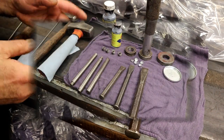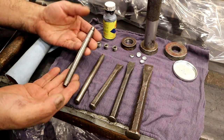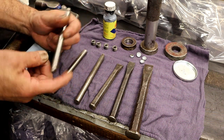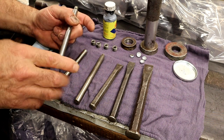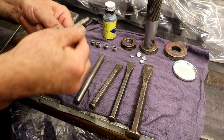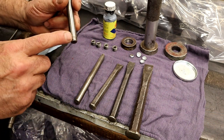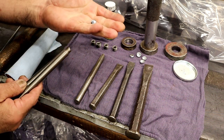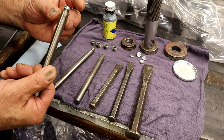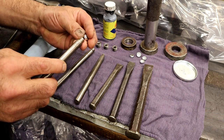Here are all the tools I use to put in these little plugs. What I do is use Chevrolet fuel pump rods — if you're in this business, if not, go to a machine shop. They throw these away daily and you can get them. A Chevy fuel pump rod is the perfect length and the perfect material. What I do is machine the ends of them. I'll machine the ends to different sizes because Chevrolet also changes plug sizes and everybody has a different size plug. Here's the one I have for Ford FE — I've taken it on a lathe. You can also take it on a grinder and machine it down to fit on the inside of the plug.